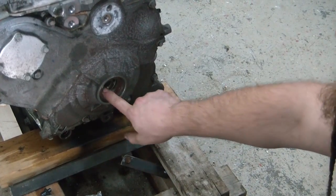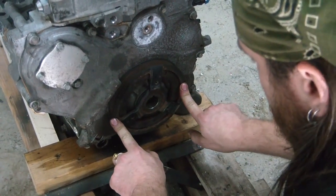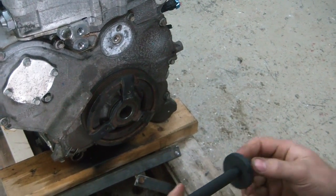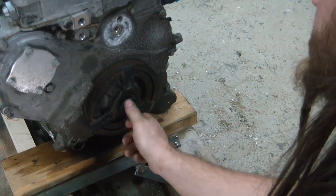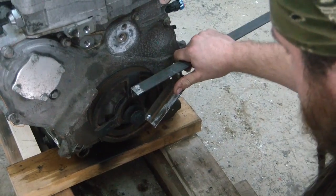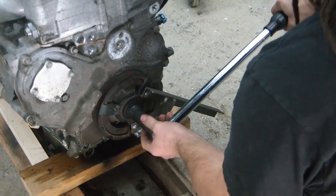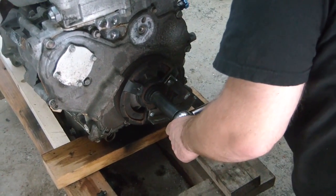Got the front cover back on. I just installed the new oil seal and got this cleaned up. The book says to put this in with a pusher but obviously you don't need one. So now we'll take our new GM bolt, brand new, and figure out the torque setting. The manual says to turn this to 74 foot-pounds for step one.